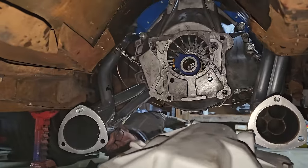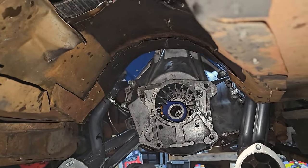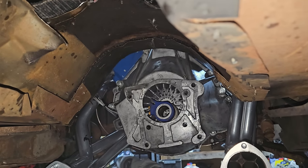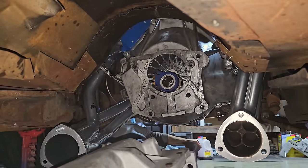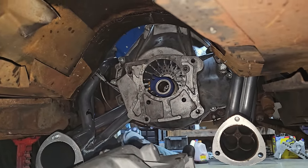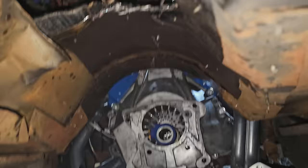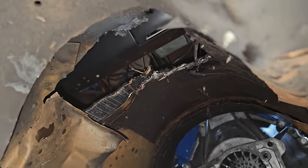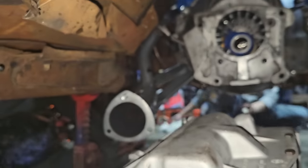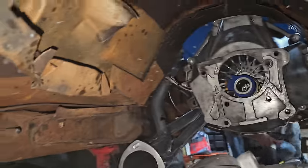Pretty awesome. Okay, now the big challenge is, see that throwout bearing, that blue bearing in there? We gotta line the shaft up with that and that pin. I've gotta simultaneously lift and press this in, rotate it, match the splines, and stab it. And we gotta be fairly gentle here because we don't wanna misalign the clutch and all of that stuff as well. And we've pulled the whole shifter assembly out, so this is flatter. Tony's gonna try to guide me. Jason's jacking. We'll see what happens.